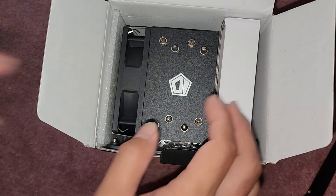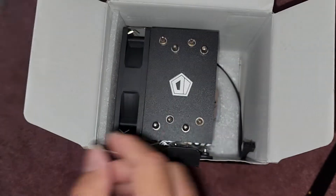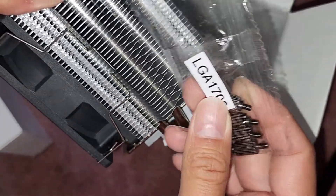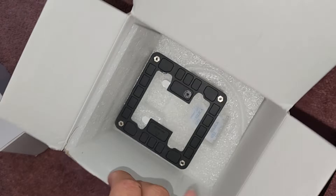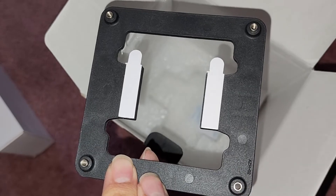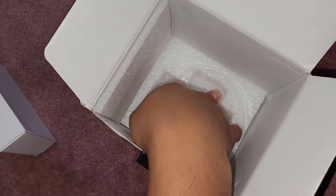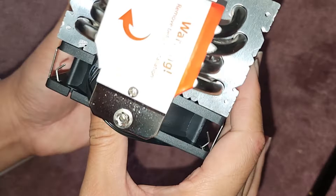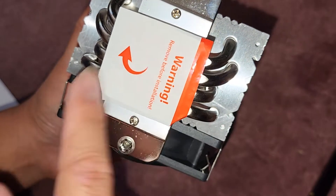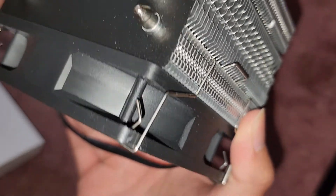Let's take this out. Here is all the little different metal mounting tools. Here's the LGA 1700 stuff — they added that as people started needing it. Here's the mounting hardware for Intel. It does come with its own thermal paste, so we'll find out if it's included. Make sure that you remove this plastic thing before installing it, because if you don't your computer's going to overheat.